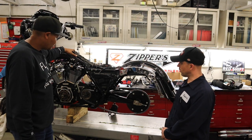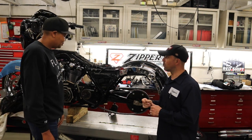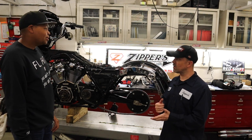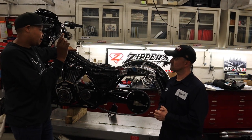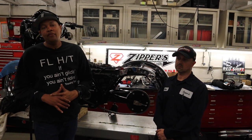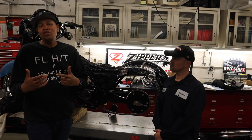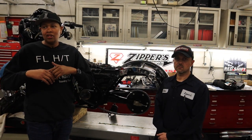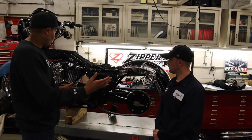It's that initial shock that always gets it. With a chain, you won't have to worry about that. I've seen teeth actually come off the belt, which is bad. The enemy of the belt is big power combined with traction. On the street with a regular street tire, the bike will spin a little, which is actually easier on the belt. But when you have a track-prepped surface and a good tire on the back, all that initial shock can just snap a belt — that's why we go to chains.